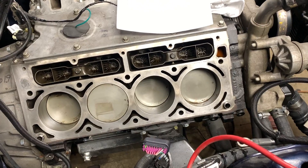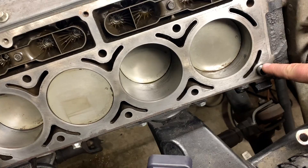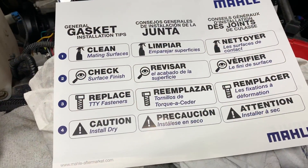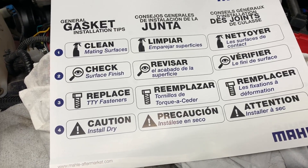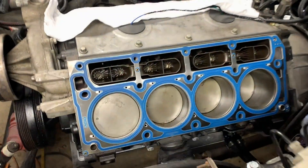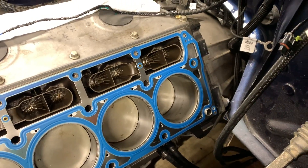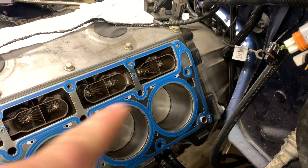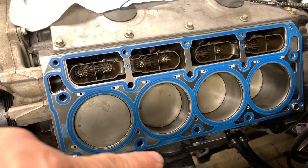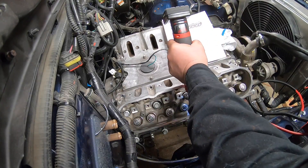The block and head have been prepped, so let's get the gasket on. First, make sure your alignment pins for the head are already inserted. Before you install the head gasket, check over your list and make sure everything is prepped. When you look at the head gasket, it says 'front' — you have to make sure that faces the front because the water jackets are in the back. That's very important; if the gasket isn't installed properly you'll be doing it all over again.